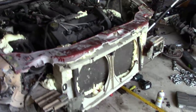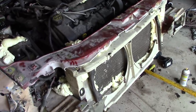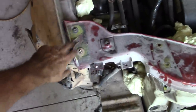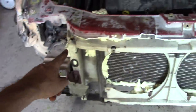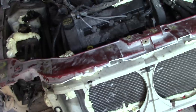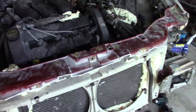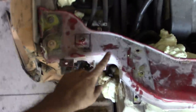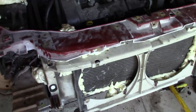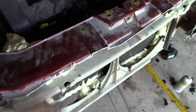Quick update on what you see here: the Sable is coming back together. We have the fiberglass core support and radiator mounts all from my wagon — that stuff was all usable, I'd saved it back knowing I'd probably run another one someday. We got it back in the original position, bolted in the factory spot. It just doesn't quite sit down like it should, so this top piece is literally spray-foamed in place — I just jammed some spray foam, glued it down, called it good. The part that matters on these is this corner connection right here; that's what truly holds the whole thing in. Once those brackets shatter and those corners go, this whole thing just drops to the ground. I'm probably going to wire it to the hood or loop something through there to help hold it up in case those break — typical Taurus issues.